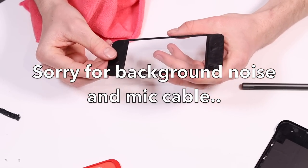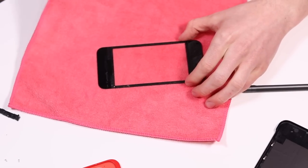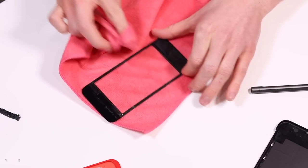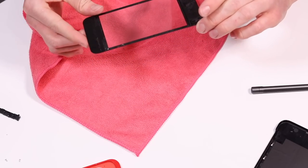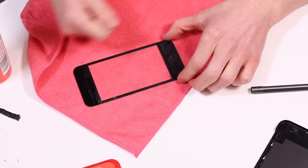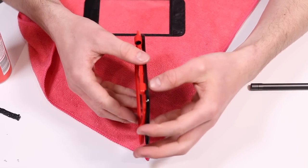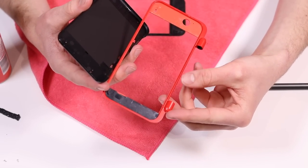I have actually managed to get the screen out. Basically there's some adhesive, like a little sticker, all the way around the front. I essentially separated the two glass layers in an LCD screen — and in between that is the liquid crystal stuff. Probably not the nicest way of doing it. I probably could have used a hairdryer first. But what I actually ended up doing was hairdrying the whole thing in order to separate it. In the process I managed to break this, but I don't need to glue it because the back piece holds it all together, so it's only going to be an aesthetic thing.